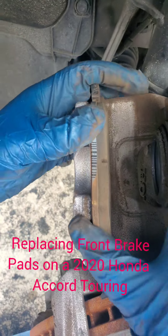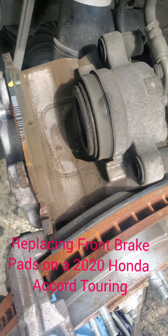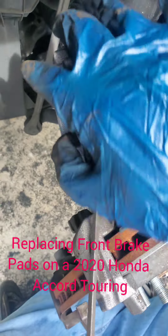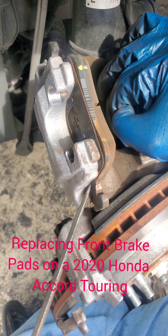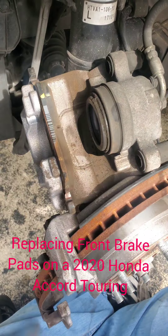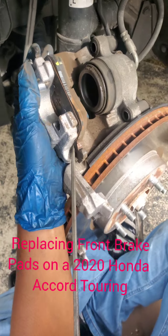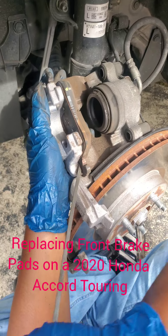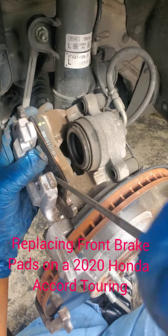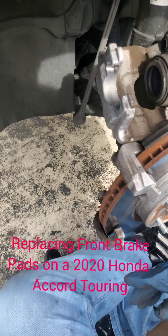Rest the inner pad on the corner. The outer one is kind of confusing, but once you get to know it — if you look at the new one, there's a piece that's actually glued onto the caliper bracket itself. So you just use a flat head screwdriver. Don't think it doesn't hold on strong — it holds on very strong. You pry it a little on both ends until you get it to release off. As you can see how tight that was glued on to the caliper — just put that aside.